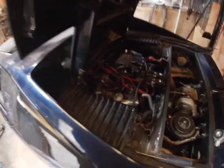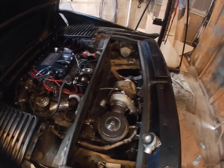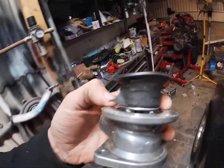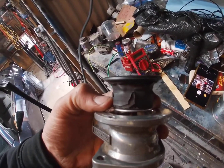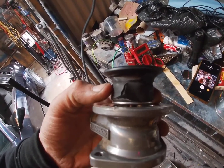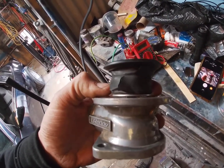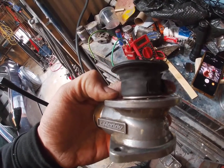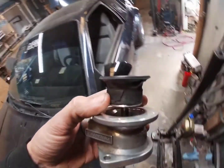As you can see, I've got some oil catch cans set up and I've got my turbo. My next video — I haven't got the parts yet — but this is my Greddy blow-off valve, and as you can see the diaphragm is totally shot. We were making boost only like one to two pounds; when we first did boost we hit four pounds, and ever since then it's just been compressor surge. I took this apart and the diaphragm is all destroyed.